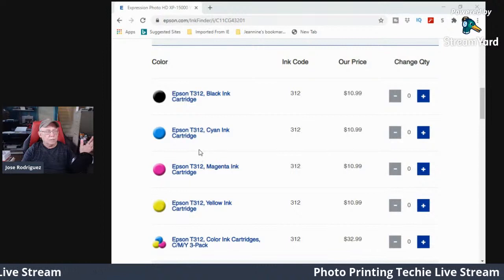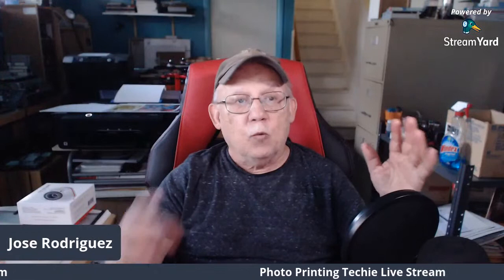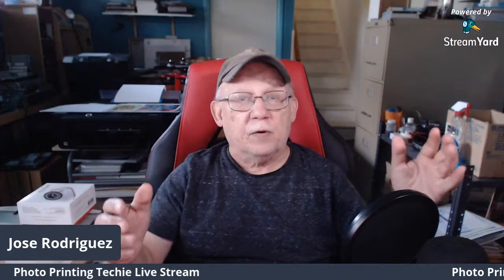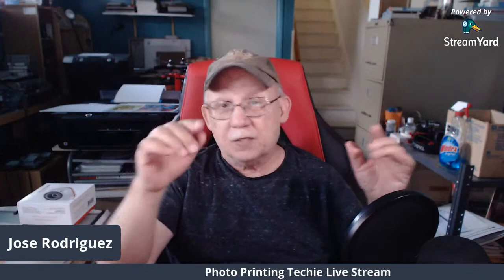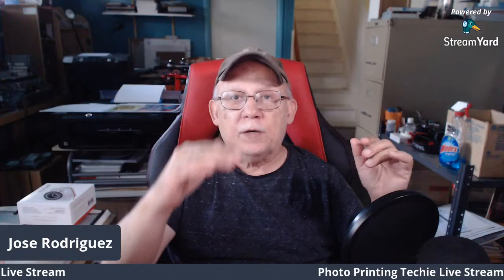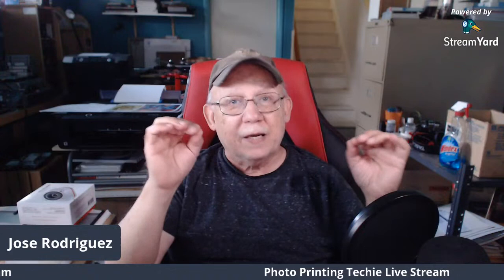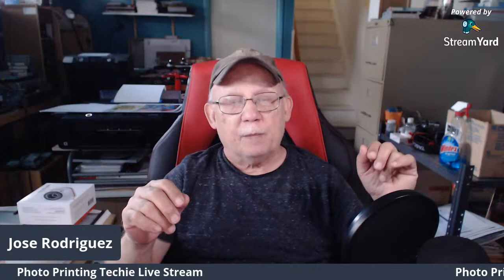Now, yeah, but Jose, every time you take them out to weigh them, and then if you choose to refill them at that point by dribbling ink until that port, again, it's like a nylon. It's not a sponge like the Pro 10 cartridges. It's not a spongy fibrous material. It's more like a nylon cloth, a woven material, and underneath there is some kind of absorbent padding that the ink passes through. As soon as you see that little port surface glistening, it's becoming wet and saturated, stop at that point, squeeze and blot, and then let go.